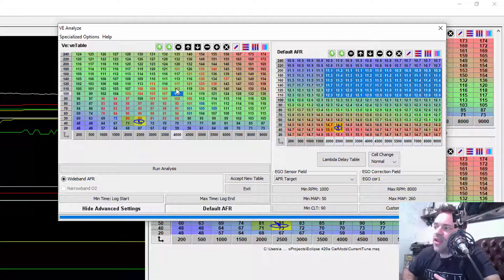Now I want to make sure this is smooth. As it goes up it increases, as it goes down it lowers. As it goes right it increases, as it goes left it lowers. You see here 13, 17, 13 — that's not right. It lowered the values everywhere above the threshold and didn't touch much from here to the bottom except these three cells.